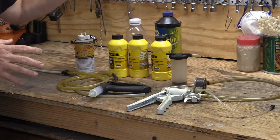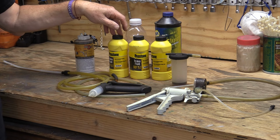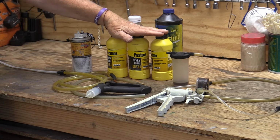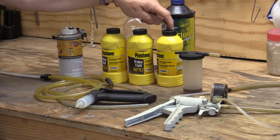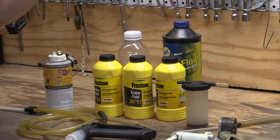If you work a lot by yourself, there's a couple of different ways you can go at it. And I've got here on the countertop the brake fluid that we're using, which is a DOT 5.1, which is, as we've talked about in the last episode, see the link below me here. This is a glycol-based fluid that you can use on your car. You can also go with a DOT 4, whatever, to bleed the brakes.